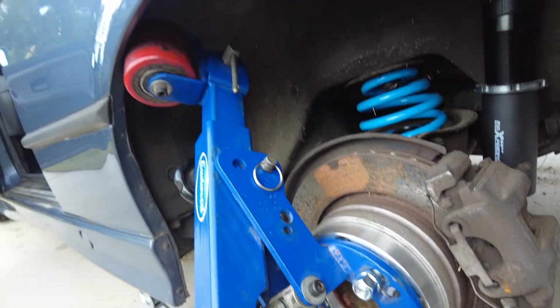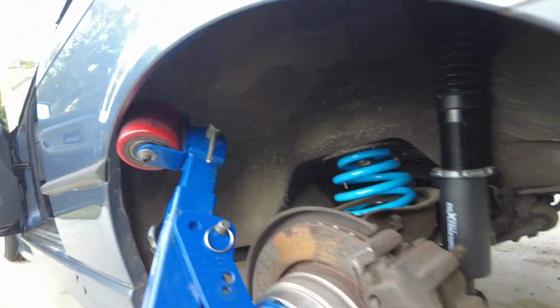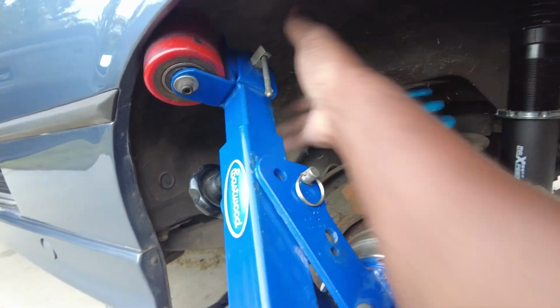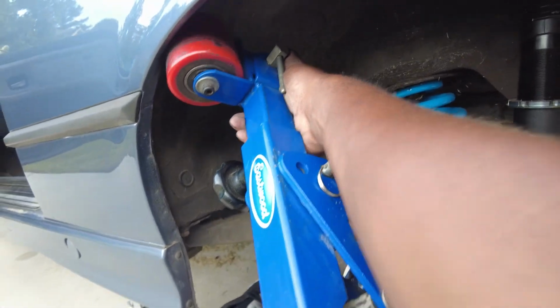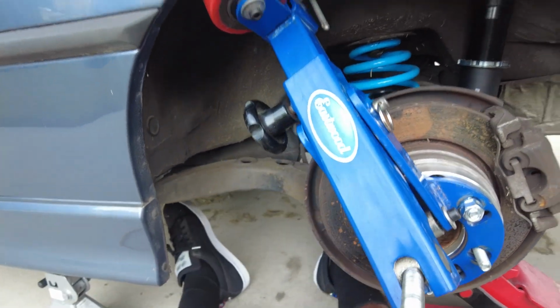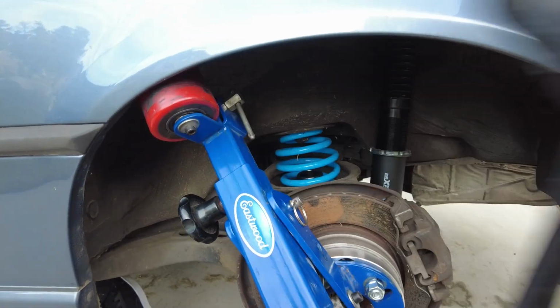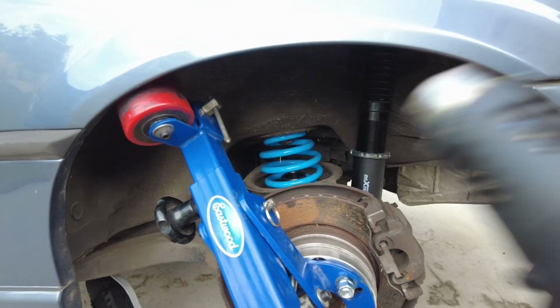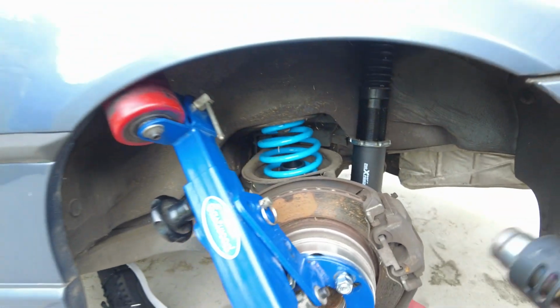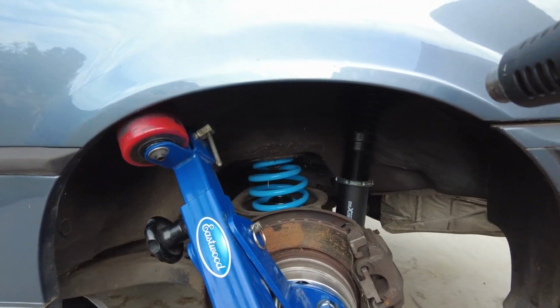Alright, finally got this thing set up how I want it, starting in the corner because that's the furthest, and then it's going to get tighter as you go this way, back and forth. So that is a good place right now. Like I said, you can see it's kind of tight, and I can tighten it with this when I twist it. But before we start, we're going to go ahead and heat these fenders up so they don't crack, because it will push a little bit, but mainly we're pushing the inside more than the outside. Either way, gotta heat the fenders up.